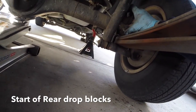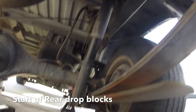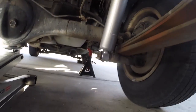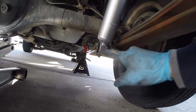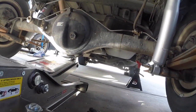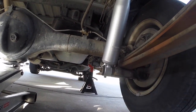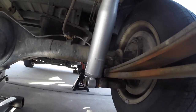The rear is a lot easier — it's a matter of just putting some blocks in between. I'm going to change out the rear shock first. All I have to do is take off the bottom and top mounting points. I've got the rears on — really easy. This is my first time lowering a truck and these were super easy, just two 14mm bolts. A little trick: put a jack under the solid axle so you can lift it up or down. It was just slightly off, so I lifted it a little and was able to slide the bottom of the shock right on. Both shocks are on now.